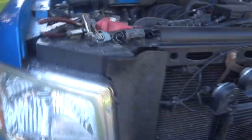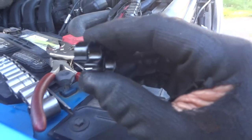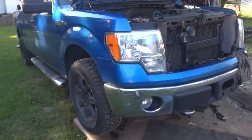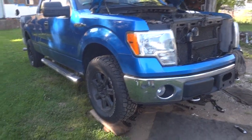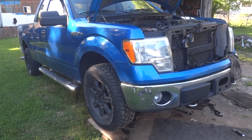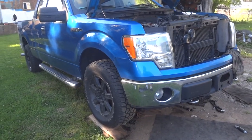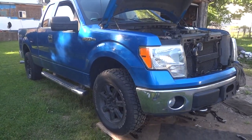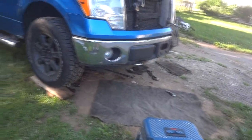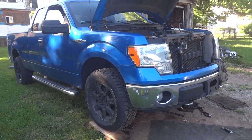This job is done, guys. I hope you enjoyed this video. It wasn't a perfect video, but if you're sketched out about getting those lines up under the engine like that, like I said you could take those two bolts out of the transmission mount and lift the engine up a little bit — that'll give you enough room to really make your job easier. But that's how I did it. Thanks for watching, and until my next video — see you later.